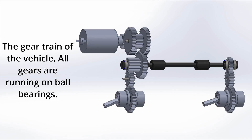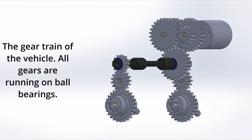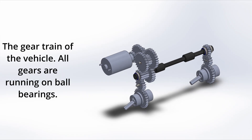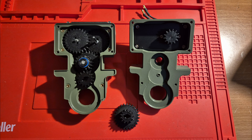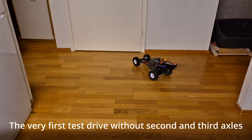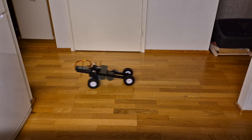After some consideration I decided not to add central differentials either — that would have complicated the design far too much. The reduction ratio in the drivetrain is 1 to 24. The drivetrain is relatively simple in theory, but rather complicated in practice because you need a lot of gears to achieve that reduction ratio — that's just a limitation of 3D printed gears: you cannot make them particularly small. The vehicle is now fully drivable, but obviously missing the body and final touches. I decided to leave those for a future video, just to get this video out sooner.